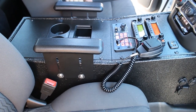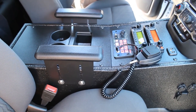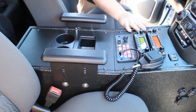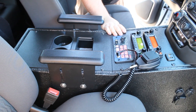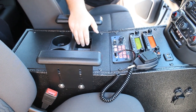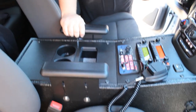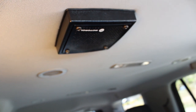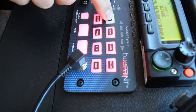What we're going to be looking at is one of our custom angled series consoles. What we've done is reintegrated the factory USB and audio jack for the sound system, mounted their two customer-supplied radios, and also mounted the SoundOff Signal Blueprint remote controller. We've also added armrests, a small pen storage, and cup holders. Looking up top at the headliner, we've recessed their radio speakers into the headliner, which projects the sound down at you and helps you differentiate between which radio is talking.